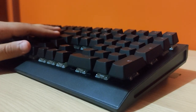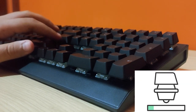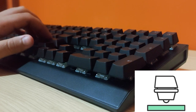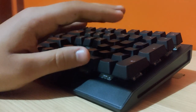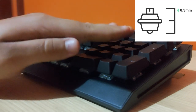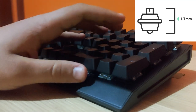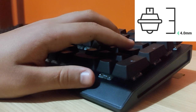So what do I mean by analog keyboard? Well, unlike most other gaming keyboards, it's capable of sensing how far you press a key at varying actuation points due to the different switch design, which I will explain later. But basically, if you ever find yourself making accidental key presses or the switches are a little too sensitive, you can just move down the actuation point until it doesn't happen anymore, allowing you to keep that comforting lightweight feel and retain that fast actuation.